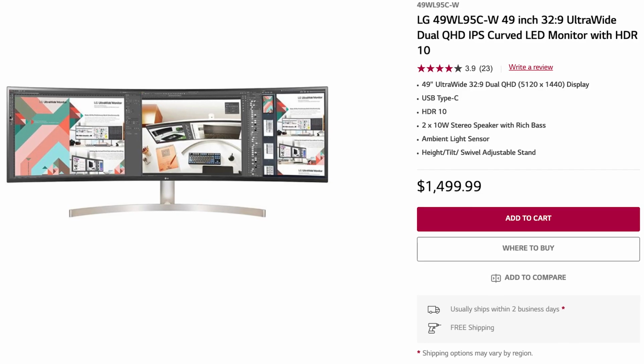So before we get hooking it up, let's just go through a few of the tech specs. The screen is a 49-inch ultra-wide curved screen that runs at 5120 by 1440 on a 32:9 with an 8 millisecond response time. And the screen is actually the exact same display panel as the LG 49-inch model. Both run at 60 Hz, although I believe I've read that this one can be overclocked to around 76 Hz reliably without it cutting out or doing anything. Color accuracy, of course, is excellent out of the box, provides 99% sRGB, which is drastically different to the actual LG version of this monitor.